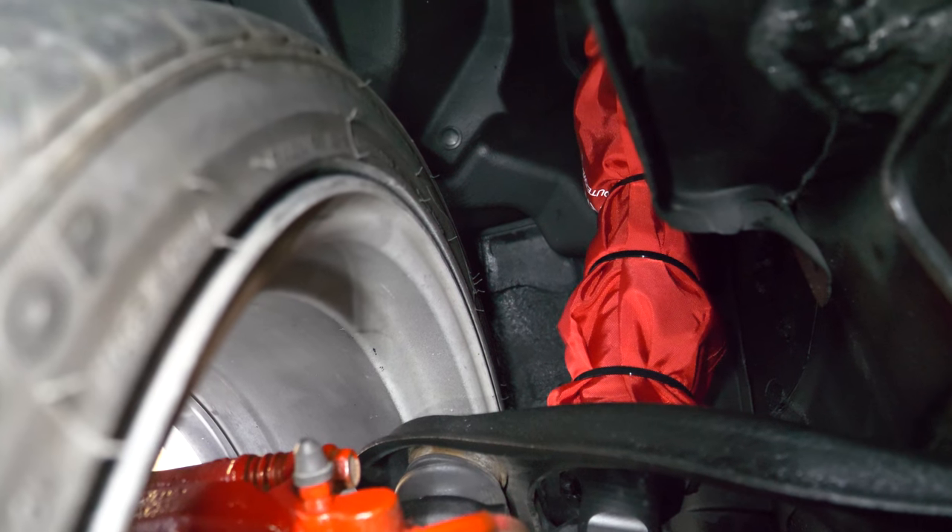So with my car fully protected and ready to go, I'm ready for winter. Now for these coilover covers there's two different sizes - there's a three and a half inch outer diameter and a five inch. I went with the five just to play it safe because I wanted the coilover to be completely covered from the elements. What I would do is get a measuring tape, measure the outside circumference of the biggest part of your coilover, and that's the size cover that you need. Worst case scenario, get the big one and put zip ties on it. So if you guys want to pick up any of the products I used today I have everything linked in the description box.